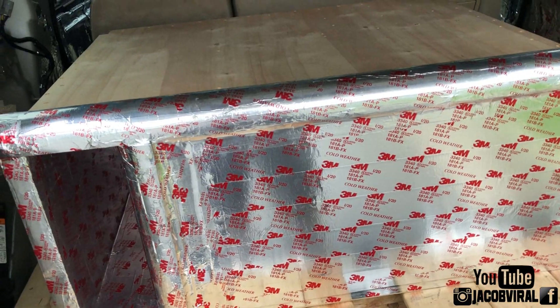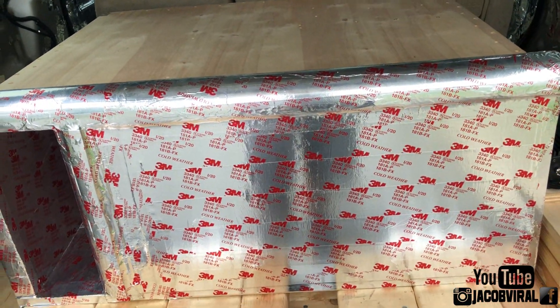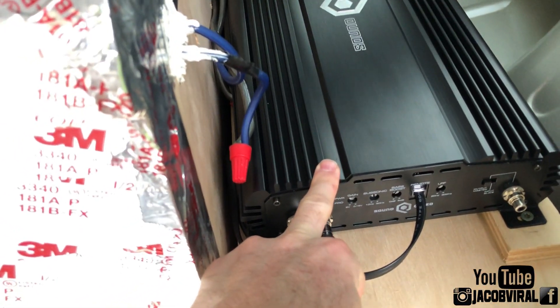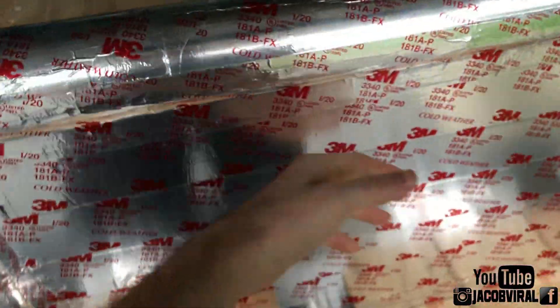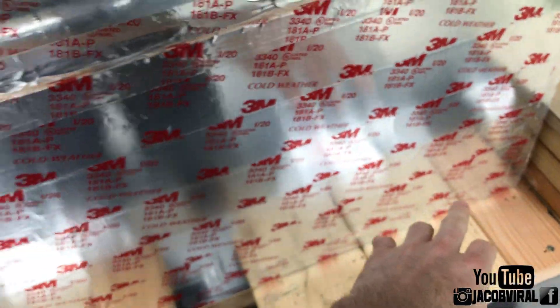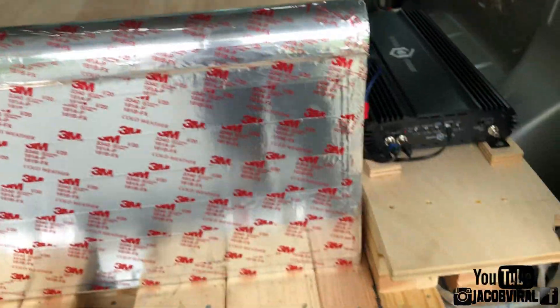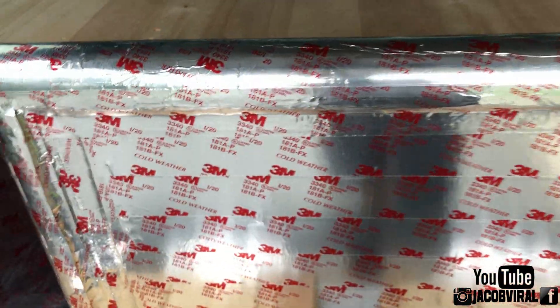Of course also power — I'll eventually be upgrading my power. I'm also going to adjust my baffle, adding some roundovers. I'm going to do some tweaks to the box, adding 45s, adjusting my sealed section, and trying inverted versus regular mount. I'm going to be doing some improvements on my amplifier wiring as well as making everything a little prettier and cleaner.